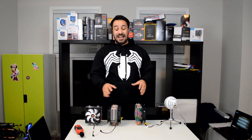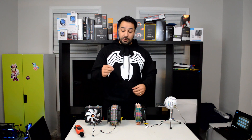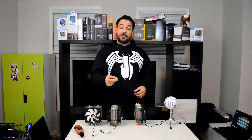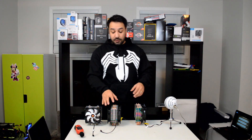So as you can see, this wraps up the findings. Push-pull, if you're looking to max out performance, is not worth it on these budget coolers — you're better off paying for a cooler that was designed to come with two fans to begin with, and most of those will actually include two fans in the box. The fin stacks just don't restrict airflow enough where the second fan actually helps at max performance. However, I'm not going to say push-pull is completely useless, because for someone looking to get a whisper-quiet system and wanting to lock their fans at 50% while still getting close to maximum performance out of their cooler, that's actually quite a good use case for going push-pull.